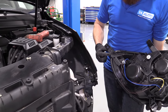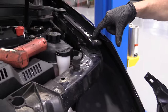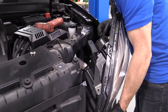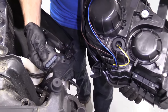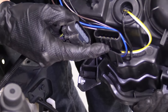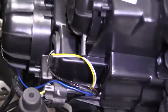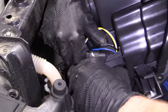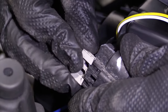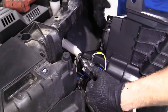I just wanted to show you on the top ear up here, where it slides in — it's just got a little prong that goes down into that hole, just kind of keeps it anchored. So when you're putting this in, you want to be careful not to mess up the paint on your fender. I've got my little clip here — it goes right there. I'm just going to slide it in. Just make sure it's down and in. Grab our lock — this just slides right in. There we are, we're locked in. Give the connector a little tug — it doesn't slide out. If it slides out, obviously it's not locked in right.